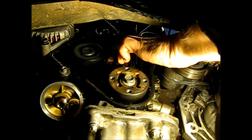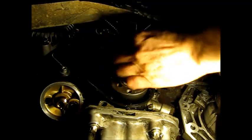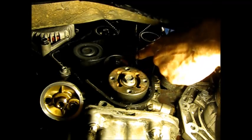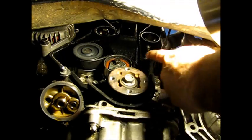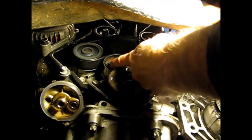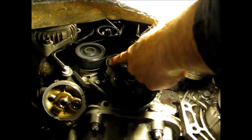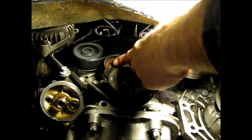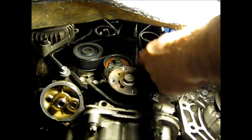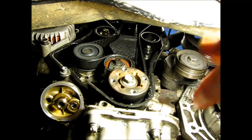As you turn this, I turned it counter-clockwise and it put the tension off position. It came in here at about 1 o'clock as I'm looking at it. See how it spins — tension off, tension on. So I'll have to remember where to put it when we reinstall it. Now we've got the tension off the belt and we can remove it.